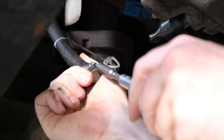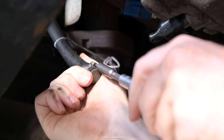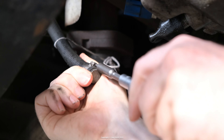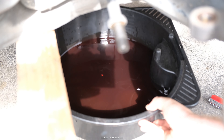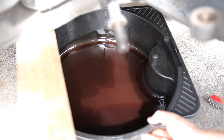To disconnect the lines there is a torx-head bolt which holds a steel plate against the rack, holding both lines in the rack body. It's a bit tricky to access and you'll need torx bits to suit a small ratchet handle — I found it easiest to turn it from the bottom, though that makes it harder to see the bolt. You'll need a torque wrench in here later to tighten it up. Once that's out, the hose fittings just pull out — they're just two nozzles with O-rings. You will get a bit more power steering fluid drain out so keep the drain pan underneath. Notice here the bits of metal floating about in the old fluid — not a good sign, but evidence of something not right in the rack, which I already knew.